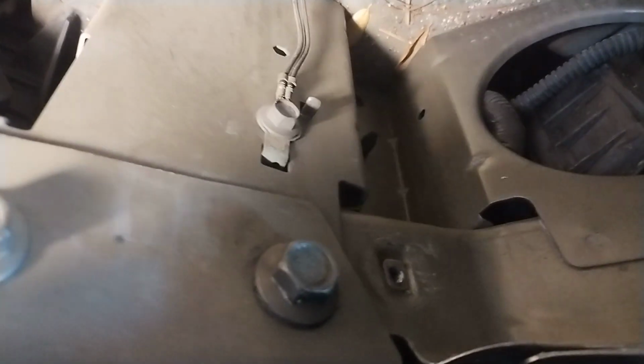It's one bolt and then it's got these little rubber mounts that hold it in. There's a screw right there that you can see where it's missing. You definitely want to take that out because it slips right out if you do that. And you've got the air charge hose on it too, and the boot, and that little clippy thing right there that's kind of a pain in the ass. Then you have to get the PCM out of the air cleaner, because that's where the PCM is. It's in the air cleaner, so it helps keep it cool.